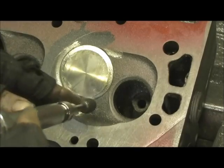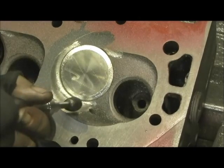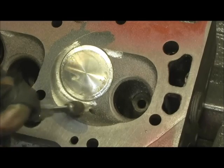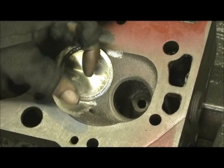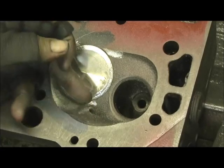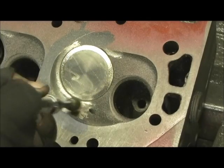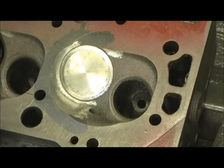Notice how I went up there and just kissed off in the trench area, just so that it forms a blend. I'm not pushing down too hard, yet I'm pulling the swoop out of it. Then you just have to stand back and look, try to eyeball and level it next to the other combustion chamber. This is the area where when the valve's coming up it needs this release - if you've got a hump here, even though you've got it unshrouded, it's not going to let it go into the bore at the angle it needs to keep the fuel atomized. Standing back and eyeballing, then taking your finger and making sure you've got the same lay-in that the other chamber did.